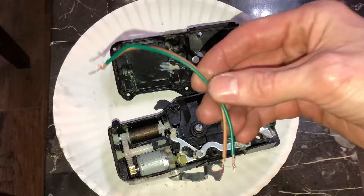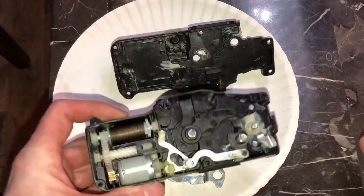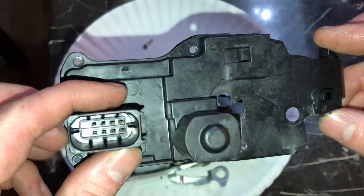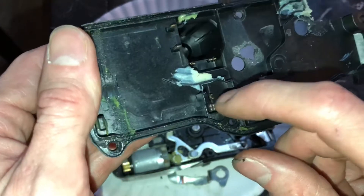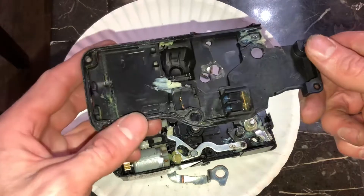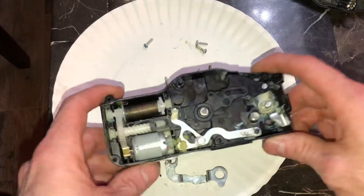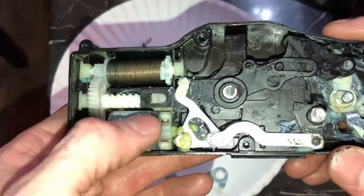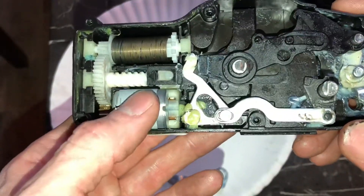I got a little power supply that I jammed these wires into and stuck it down in there, so I know that the motor is actually good. I kind of wanted to take my voltmeter and do a continuity check on all these prongs to see what goes where and what does what. I have no idea what these little things right here do — that would line up somewhere over here. I don't see them doing anything unless I lost some pieces, which I don't think I did. So chances are those switches are good. If I was going to take a stab at what's wrong with this thing, I would assume that it's probably the power connection going down into this motor — it's just not that great of a setup honestly.